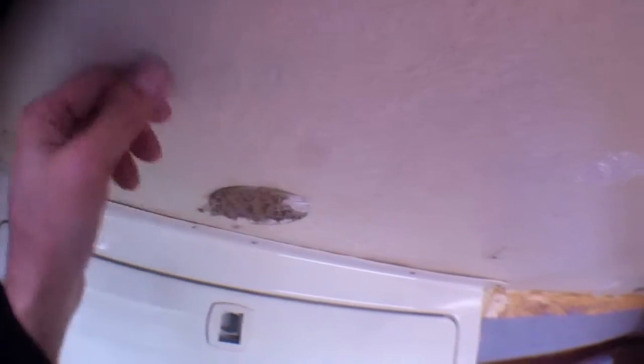So I think what I'm going to do is go and get some battening and then put a 12mm batten, bond that onto the roof, because this is all hollow as well. As you can see, it's obviously to keep the weight down, but I'm going to bond some 12mm battens, probably spaced at about foot intervals, the full length, and then I can screw the panel to that. It'll be a lot better than this, because some of the roof was starting to hang down where it'd come unstuck from the board. I don't really like how they did it. So yeah, that's the plan for today.